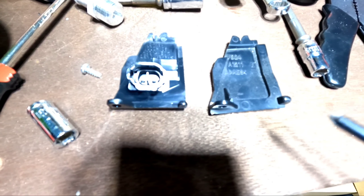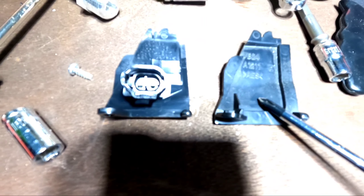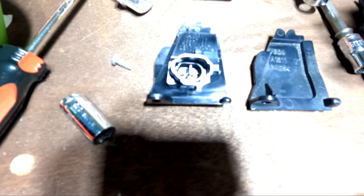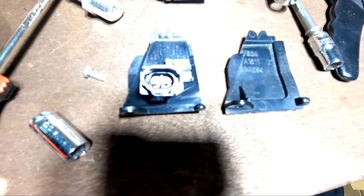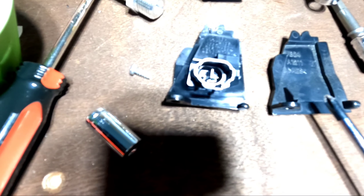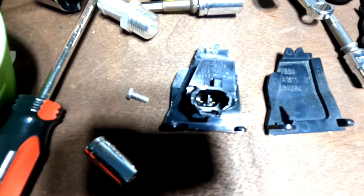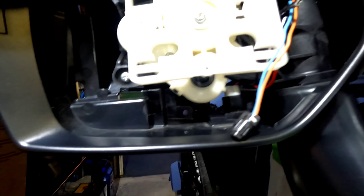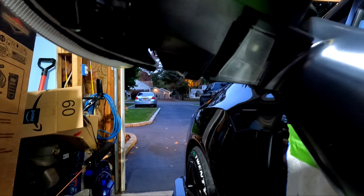While this is hanging, this Phillips head screw right here — it's a good time to take this out. This is where your pod light is gonna go. Added note: when you take that piece off at the bottom of the mirror, it's gonna have an 'L' — stands for Left side. In the bag with the new pod lights there's gonna be an 'L' above where the switch plugs in. Match them up — they're the same shape. Left and left. Use the same screw, attach it back in, and plug it up. Make sure you plug the connector in first before you screw it in. Run the red and black wire behind this white piece, extend it down, hook it up first on the outside, then screw it in.